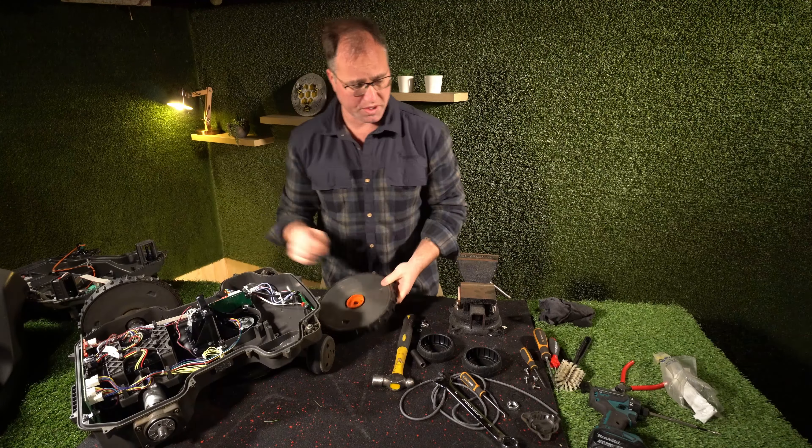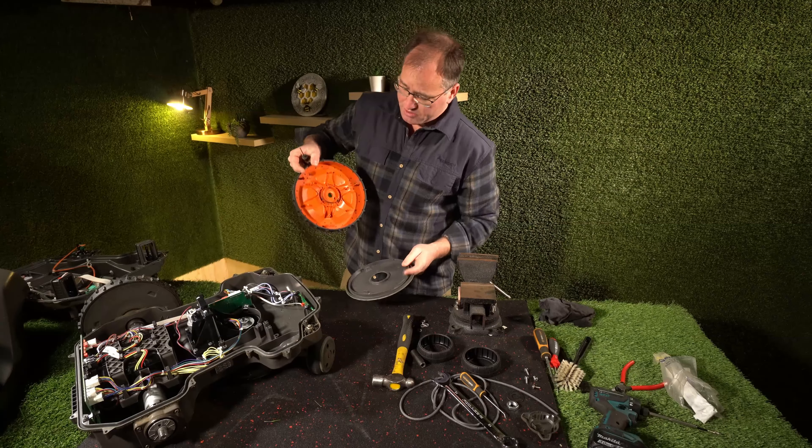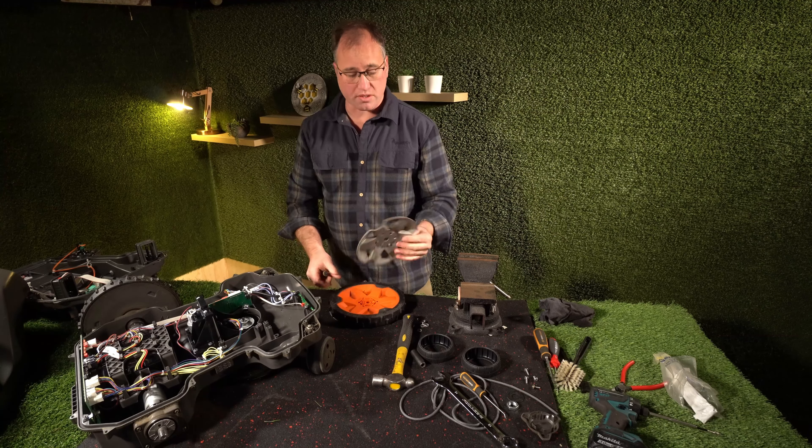For your wheels, a lot of people aren't aware, but they've got a little tab here so you get your screwdriver underneath the corner of the tab there and unclick those. This one's not too bad because it runs on a pretty tidy lawn mowed short so it doesn't pick up much stuff, but over time you will get a lot of dirt and debris build up in here. Sometimes people will say their wheels have got a real rattle sound. That can be the wheel motor itself wearing out, but most of the time it's dirt and mud going in there building up over winter or autumn, and then come summer or late spring all that mud dries and it becomes loose and rattles around on the inside making noise.